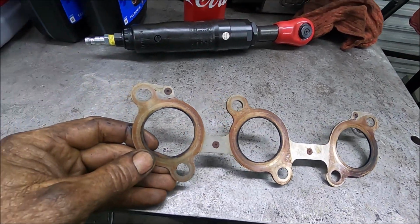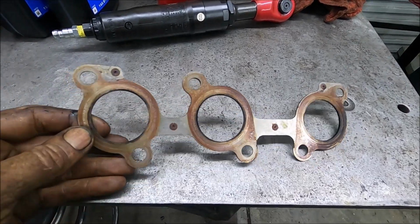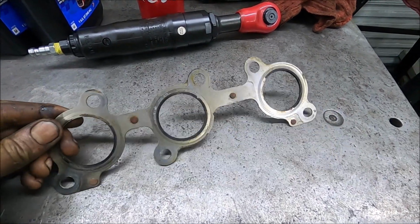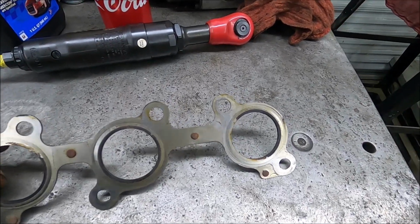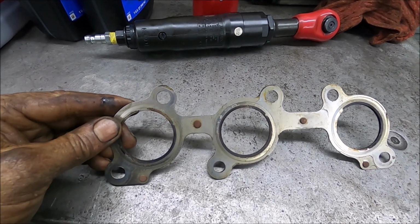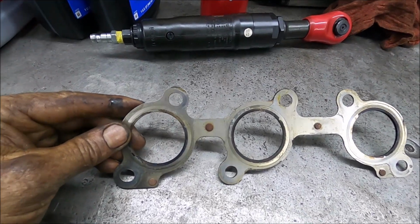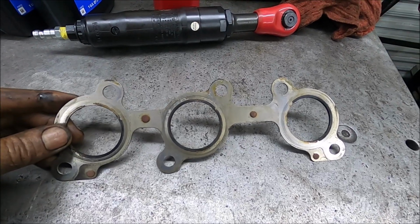And when you see exhaust manifold gaskets like this that are just thin pieces of metal that are either riveted or spot welded together, you either want to go to the dealership and buy new ones or reuse these. If you put those aftermarket ones in there that have material in them, you'll warp the manifolds. And the only way to fix that then is to either have the manifold serviced or replace them. Yeah, it looks bad if a customer's car is 20 years old and it never had an exhaust leak. You put a new engine in it and 6 months later it leaks.